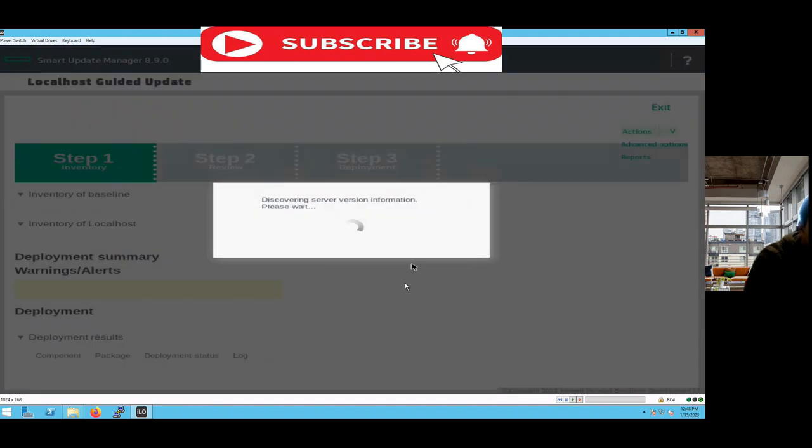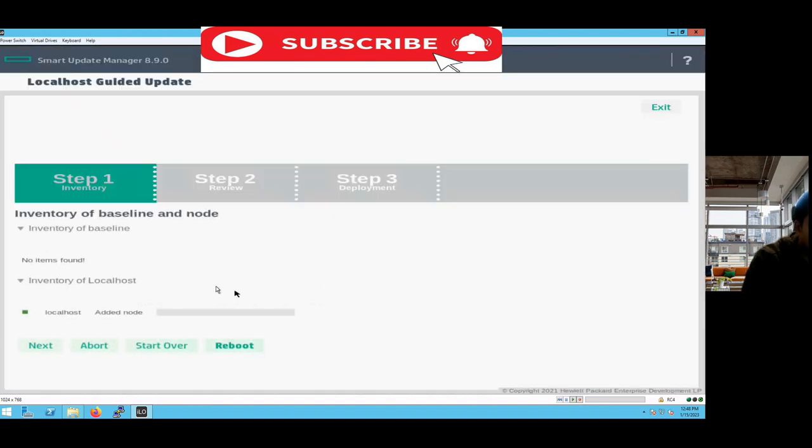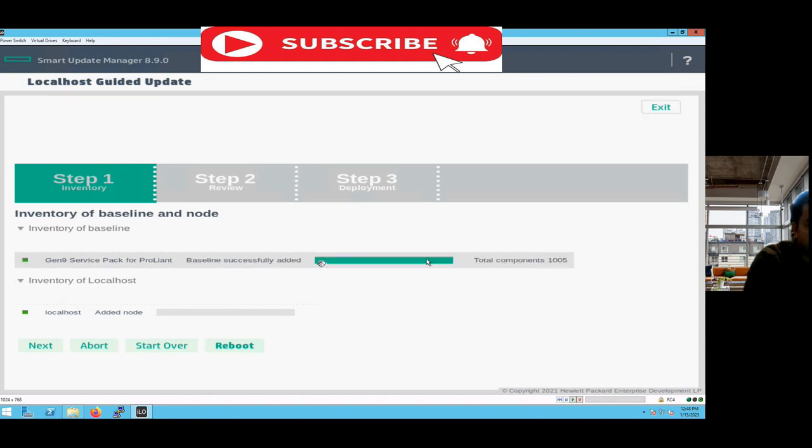All right, now it's going to load automatically, and it's going to clear the inventory. So you have to wait. It's going to happen automatically, and you're going to see some activity very shortly. Okay, see here, the Gen 9 Service Pack for ProLiant inventory in progress is going to 100%. The total inventory components found are 1,005, right? It's going to be loaded here now. It's going to take maybe 10 minutes, so we have to wait.